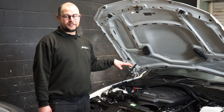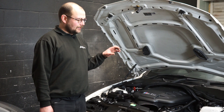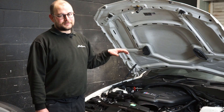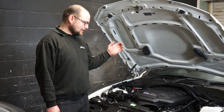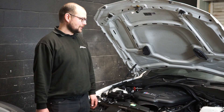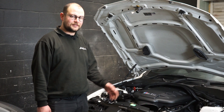The new fuel injectors and the NRW inline fuel filter kit are all fitted. I've already primed the system to make sure there are no leaks — it makes obvious sense to confirm no leaks before starting the engine. There's fuel pressure in the system, so it might take a little bit longer to get through to the injectors, but we're going to give it a first fire-up and then finish reassembly.